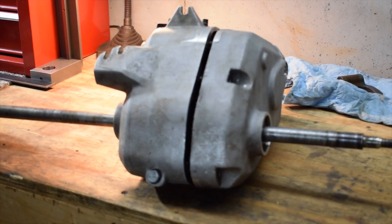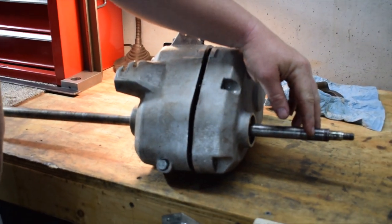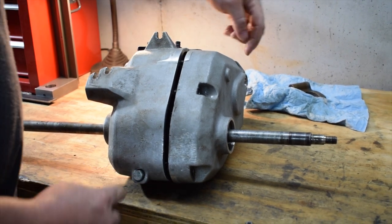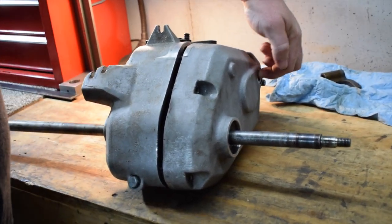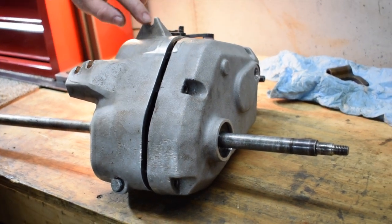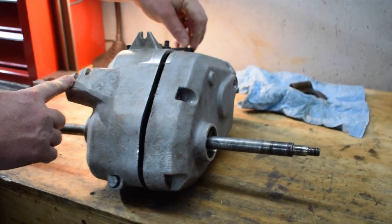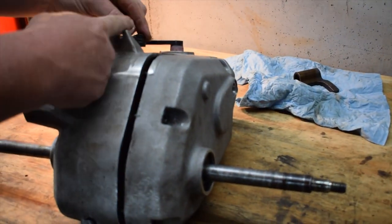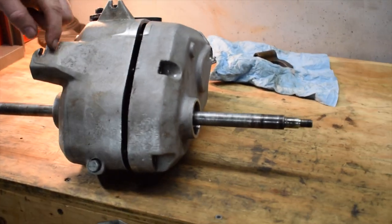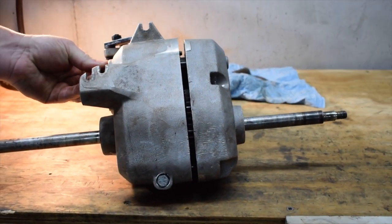Basically, these are your axles which drive the rear roller to propel the mower forward. This is a drain plug to drain the fluid, and you have a fill plug over here to fill the transmission with transmission fluid. These little hoops right here are where your cables connect. You have a cable that connects here for your reel engagement — when you pull the cable it will engage the reel. Over here on this side, there's a cable that attaches here, and this is what actually engages the self-propelled.